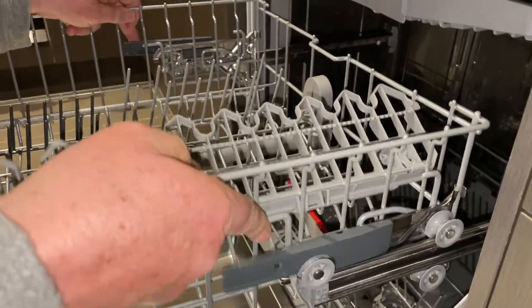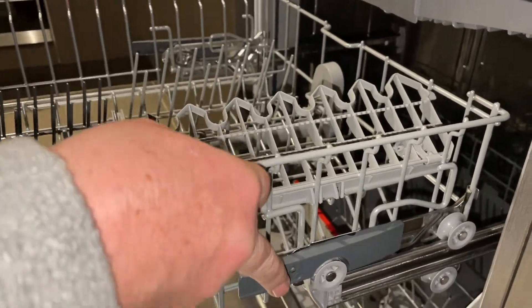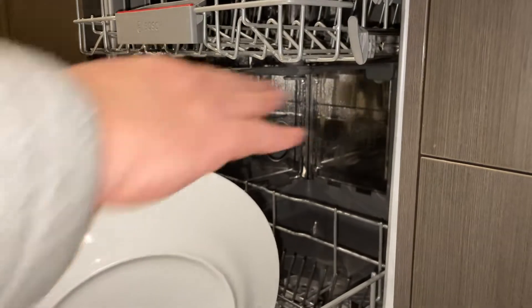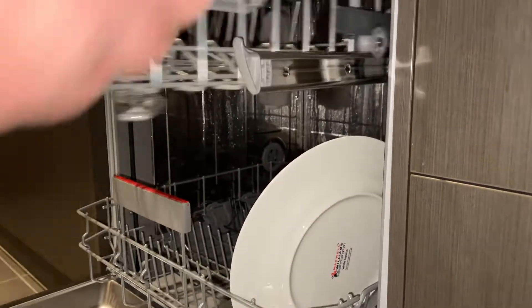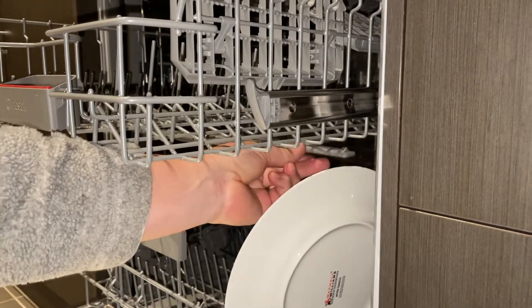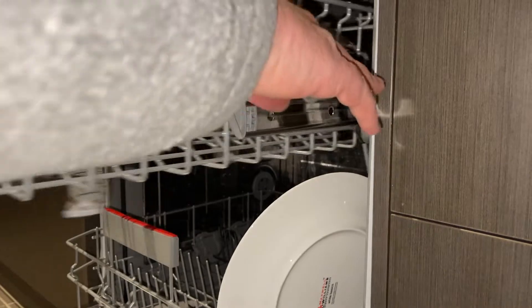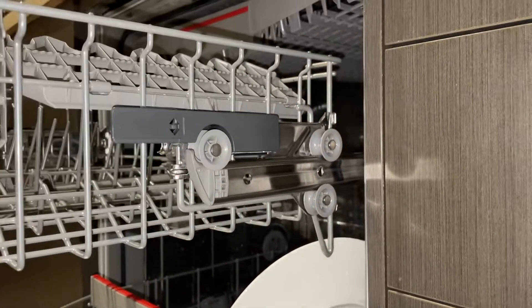It's clicking here — up, right up, it's up there. The big difference with the height: take your tallest plate, stick that in, and make sure you can spin it around. With the tallest plate in, you can see this one — we can come down one notch on both sides and clear the tallest plate with the spinner. So we're going in the middle, but you've got the full adjustment. With the Bosch it's super easy — press that in and adjust your height.